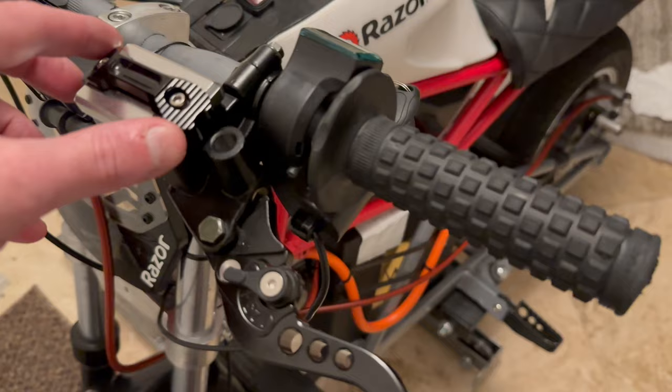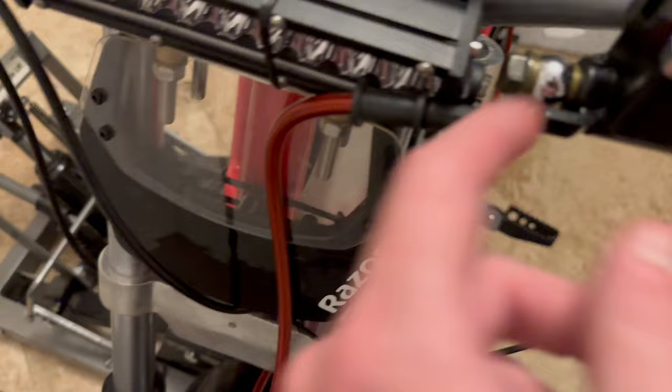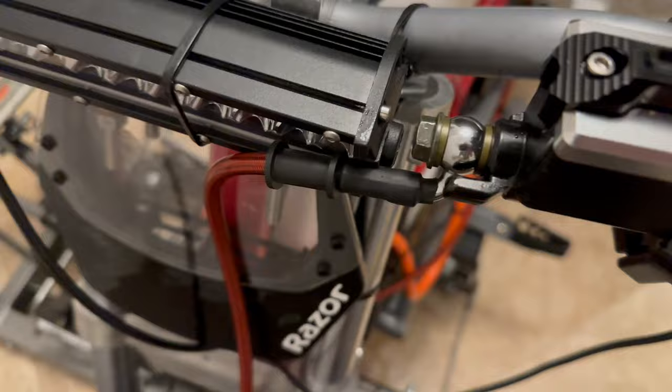What you're going to do is connect this on here. You'll open your reservoir cap, your brake line will screw in with these screws. You'll have the two washers that come on the screw - put one on each side of your banjo, tighten that up, then run your brake line down.